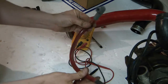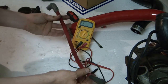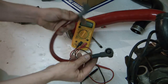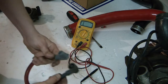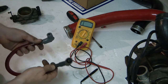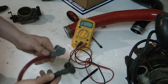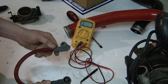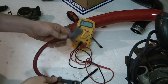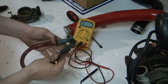The topic for today is ignition leads. This is an aftermarket one, so it doesn't look like the typical black ones you would have in your car from the factory. These will actually break over time and cause wear. Quite many cars are running around with misfiring issues on full boost or jerky throttle, especially on boost. The ignition leads are usually the last thing people change — people are good at changing spark plugs, distributors, and distributor caps, but ignition leads are an overlooked part.